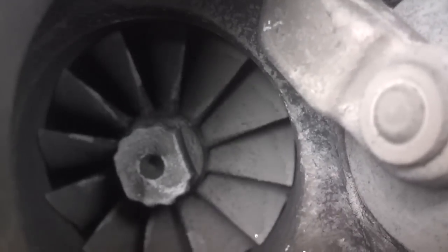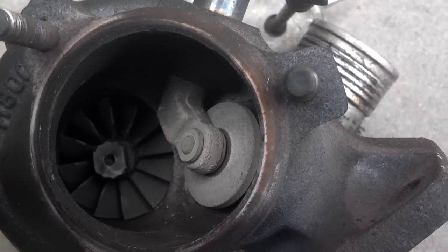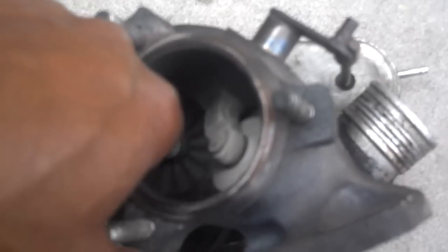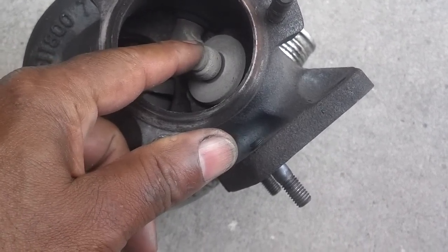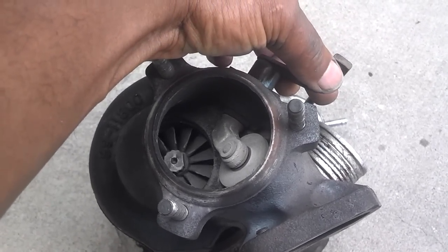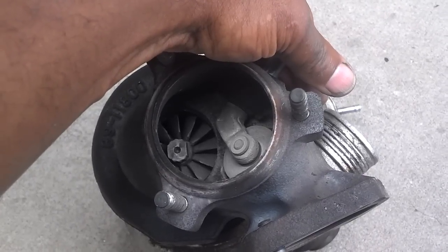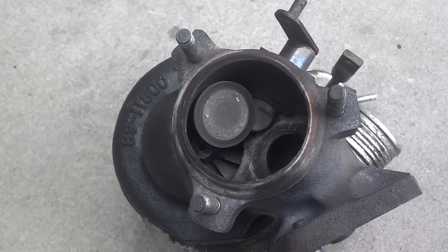You don't have a situation where you're not using your turbocharger. If something happens and it locks up, your car will basically stop running in a production or performance way — it'll probably only go 5 or 10 miles an hour because if that turbine is not spinning, it's not allowing the exhaust air to come out. What you see here is a little disc — that is your wastegate. It has an actuator that opens and closes it. Whenever your car wants to bypass air past the turbo so it doesn't produce too much air to the intake, it will open this up and bleed air off. If your turbocharger locks up, you can open your wastegate and drive your car as one that is not equipped with a turbocharger.